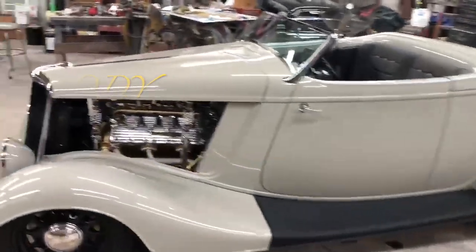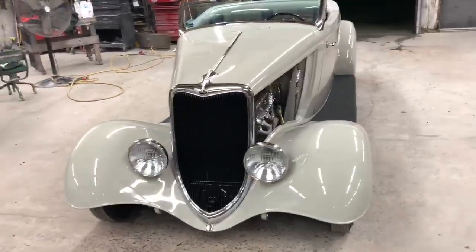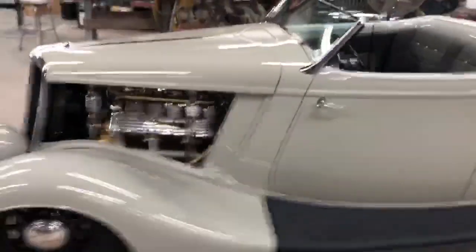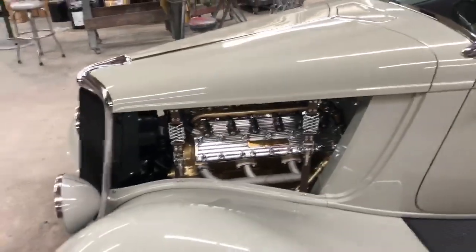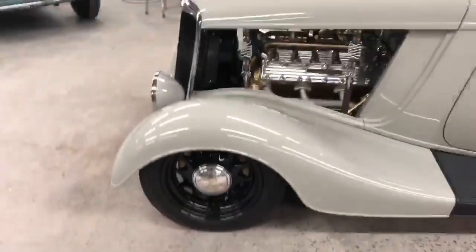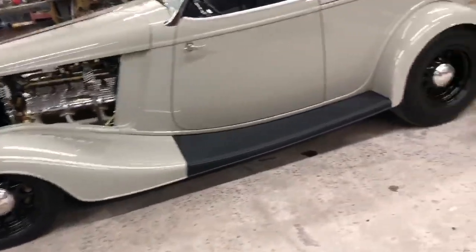We're going to go over body mods on Brandy's car. It started life as an American Speed 33-34 body — we made a '34 out of it. We pulled the headlights down in the front for a more aggressive look. We needed the grille back a couple of degrees to get it in the right direction. We channeled the front of the car about 3/4 of an inch to get it looking like it was going fast sitting still. We had custom made hood tops made with custom leather straps — I like the engine visible all the time since it was the focus point. We also did work reshaping the tops of the front fenders, with custom fender braces to get that tire up in the fender better.